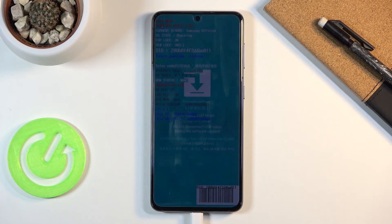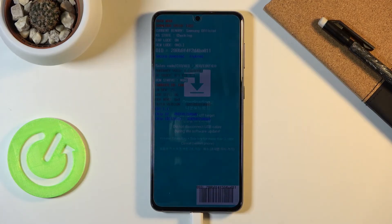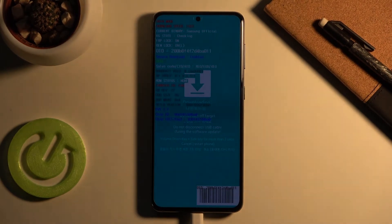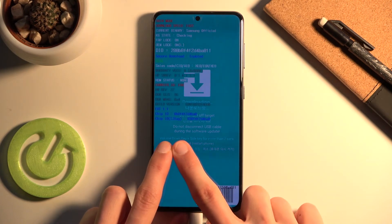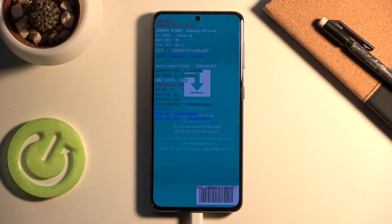And that is how you check it. Now to leave this mode, once you've checked everything, hold volume down and the power key — which is the side key — for more than seven seconds. This will basically restart the device.